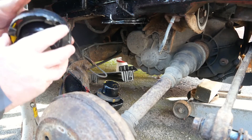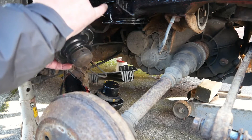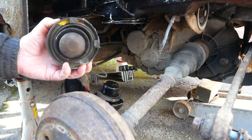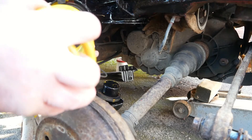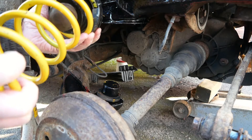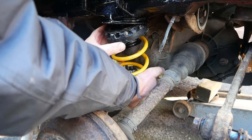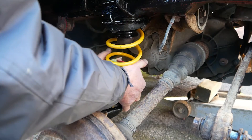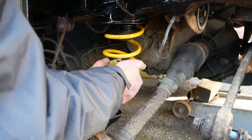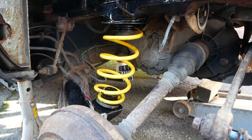This is the bump stop, and on the rubber grommet I've got a little white witness mark that lines up with that — I painted it on and then took it off. The spring slides in through these little rubber location pieces and comes to a stop just there. All I have to do then is line up the two witness marks painted with white permanent marker, lift it up in, ease it over the top, and that's it — the spring's on. Looks nice and lined up properly.